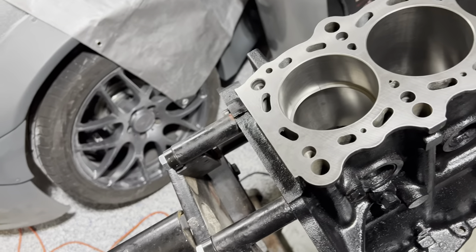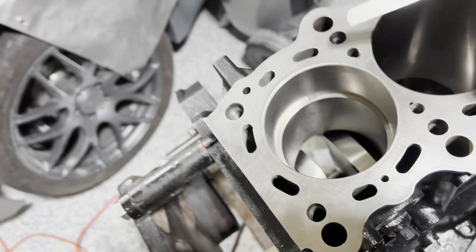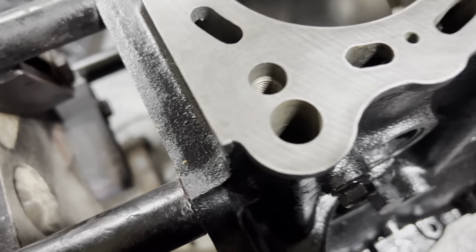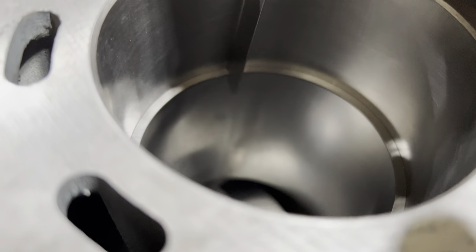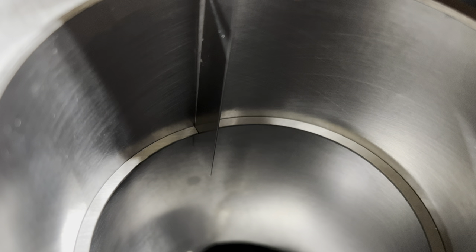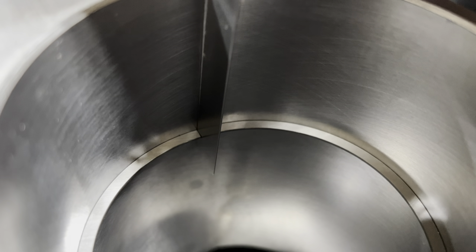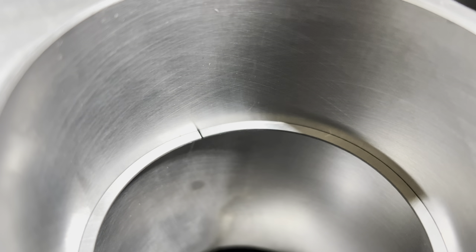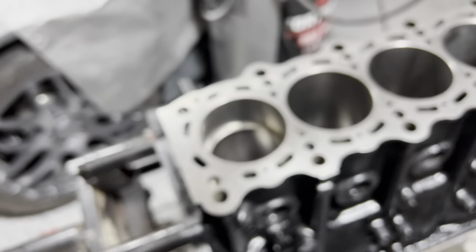So we've got 0.018. What we're doing right now — this is the top ring — it wouldn't fit before. Now we're going to send it into its bore. You see the feeler gauge in there? There's a little bit of rubbing but it glides through very, very easily. That is what you call a loose 0.018.